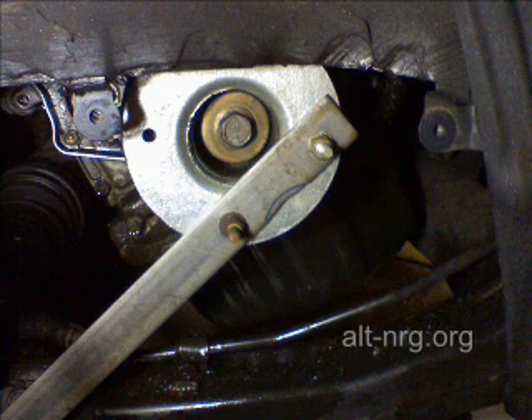In this frame you can see how I've assembled the SST into the spokes of the harmonic balancer. It takes a little jimmying to get this underneath the fender well into the spokes. You need to make sure you don't cut the black pipe too long, because if it's too long you'll never get the tool inside there. There's not a lot of room, but here it is assembled, with the exposed end of the bolt where I can now put a socket.